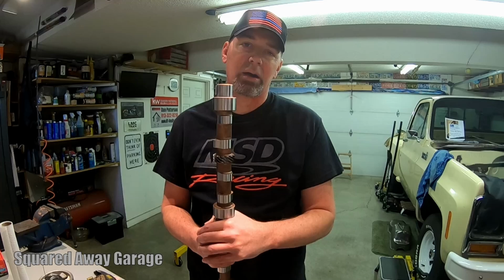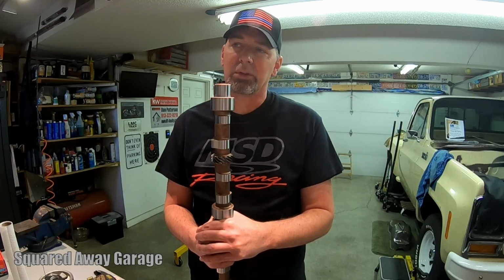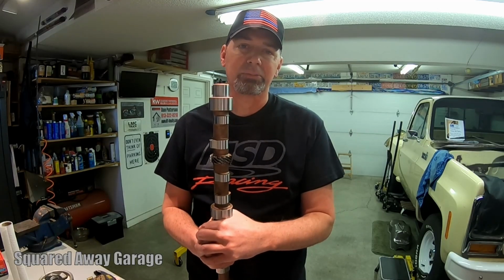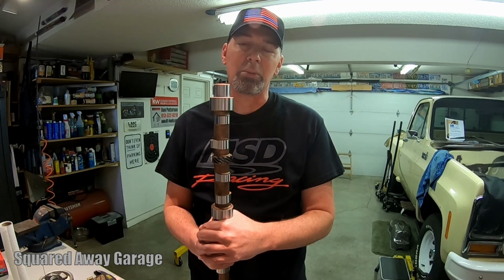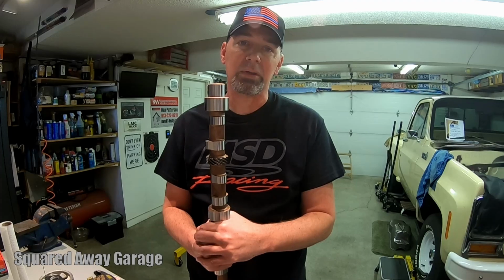And I got caught up in trying to get the spark plugs to look even. And, you know, I kind of figured it out. I was working with a feature in the ECU called injector phasing, and had the truck back on the dyno in October and proved that the injector phasing was something that needed to be explored.